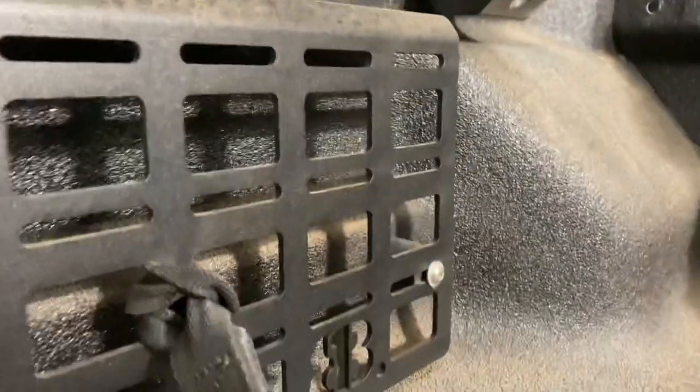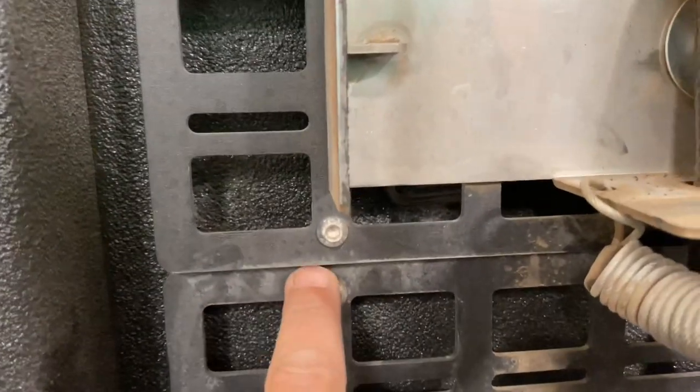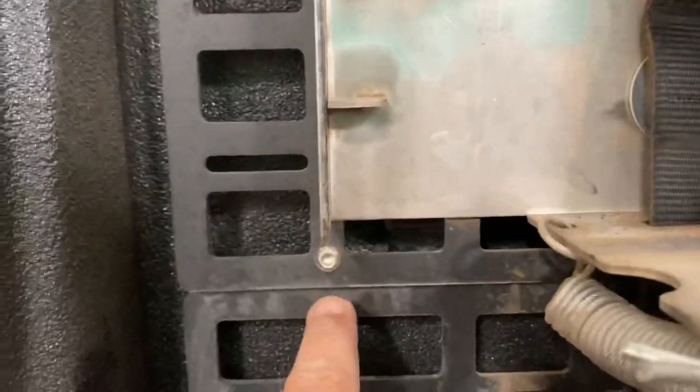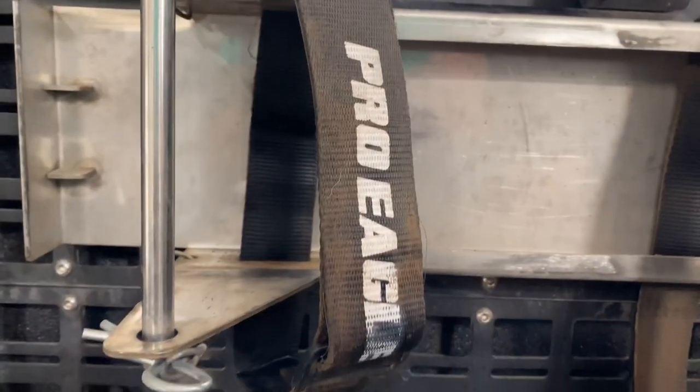Previously what I've done is put in some nut serts down here to strengthen up the lower, and then over here into the bed to strengthen the upper. What I'm going to be doing is replacing these three aluminum tabs with stainless steel tabs that Jeremy at 813 Designs provided, and also putting nut serts in the bed at these three locations so I've got three more solid mounting locations. That should be solid enough to hold this 35-pound mount on the molle panel no problem.